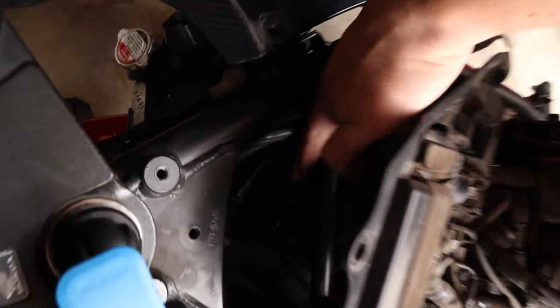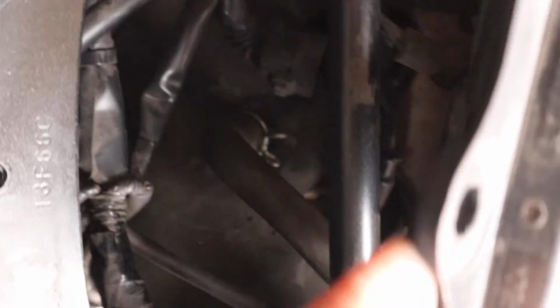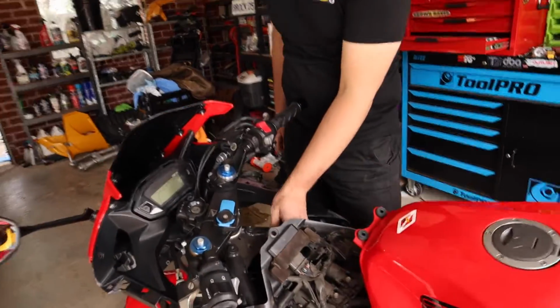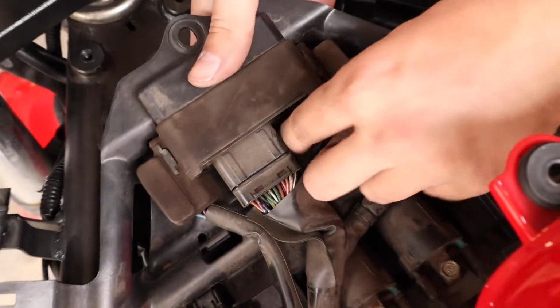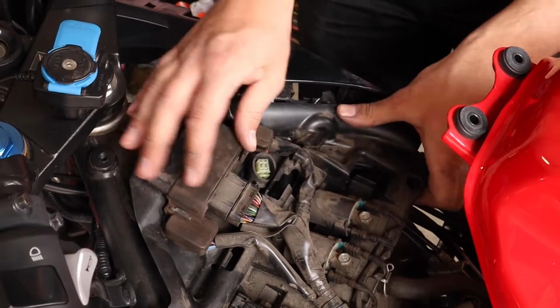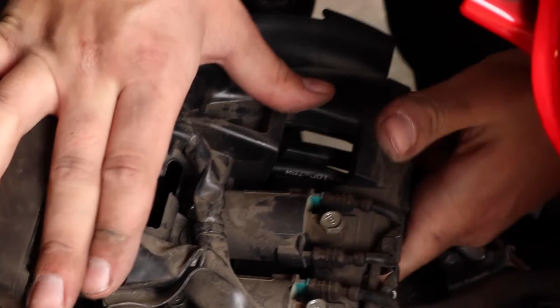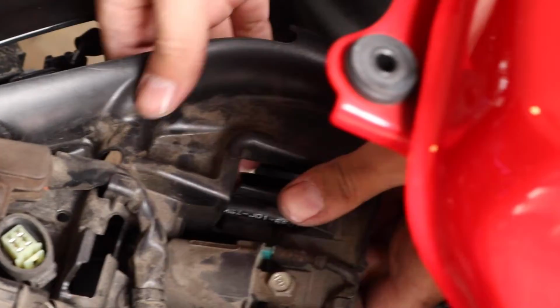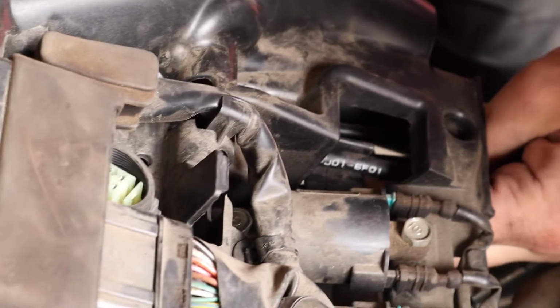That's actually relatively easy. So if you look in there, that's how that should look. You've got your little spring clamp holding the hose down. Both spark plug boots are in their correct place. Now there is a plug, which is this one here. That needs to be pushed back through the hole on this side. That goes to our relay. Put that through, and then we need to negotiate these cables back on. So we started with, there we go.